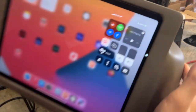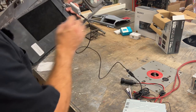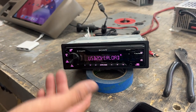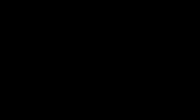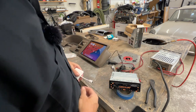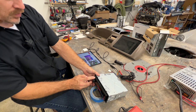Now it's charging — you see that? All right, let's see how it does on the Sony, straight into the Sony. I don't know why that other configuration wouldn't allow it to charge. It says USB 2 overload — we overloaded the USB. It's not going to work like that. I think what we need to do is go USB straight to the charger, and then USB-C to the head unit, and find a USB-A to USB-A cable.